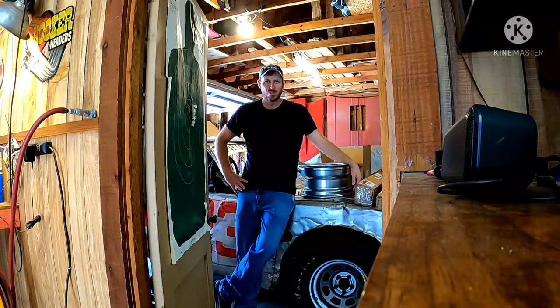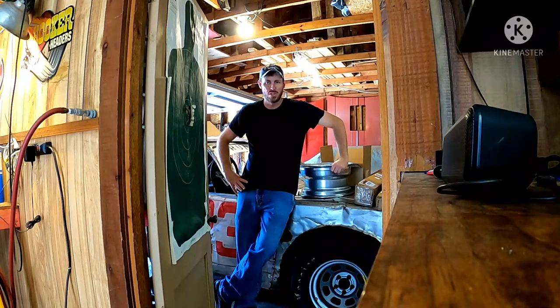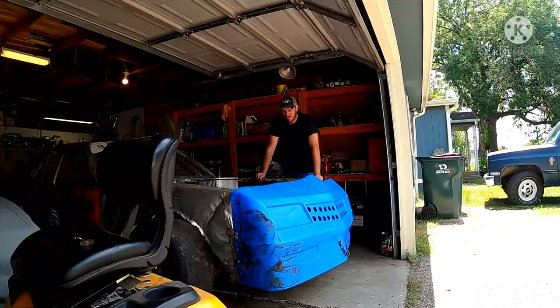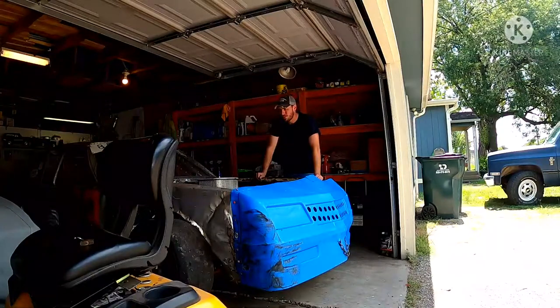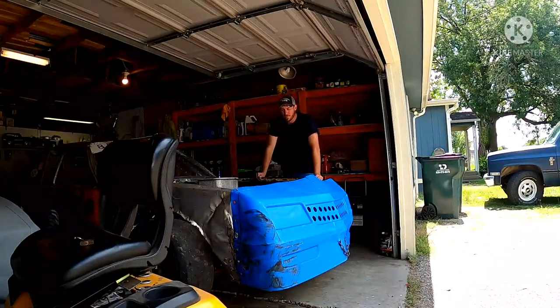We're back with the old dirt track car. Got a bunch of parts in the mail, and today I'm going to try to get this clutch situation that I've been so frustrated with fixed, or at least get started on it — so I can easily move the car around the yard or in and out of the garage. I don't intend on doing a lot of the work without my nephew, but this clutch one I want done. First thing I'm going to do is get the whole front clip off the car. I don't think we're gonna reuse these fenders, so I'll drill all the rivets out, get the front clip off, the driver's side door off, and the dash out to make it easier to cut out the pre-existing stuff and put in some new pieces of pipe for the new clutch pedal.